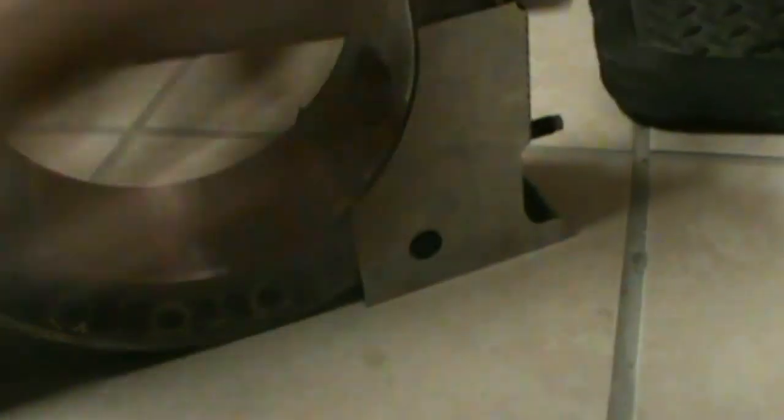The exhaust template came with this little jig here — you can see it matches the shape of the port. You put that over there, it has a hole in it, and you use the engine dowel pin again to line it all up and slide it through on both sides. You can see those little nubs there on the exhaust port — you line those all up. Once you open up the exhaust port, it spools your turbo quite a bit more, and you can see it would start spooling earlier too because it opens the exhaust a little bit early.